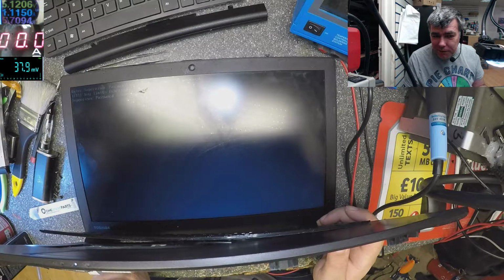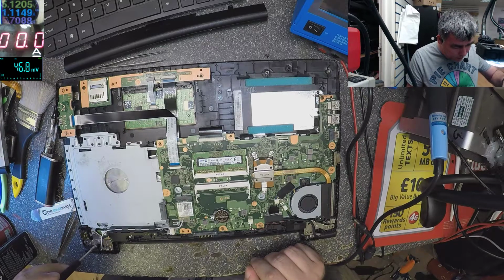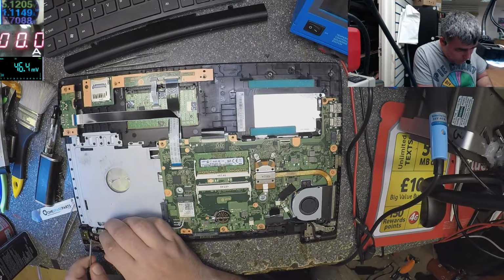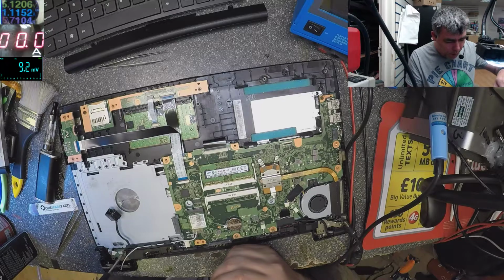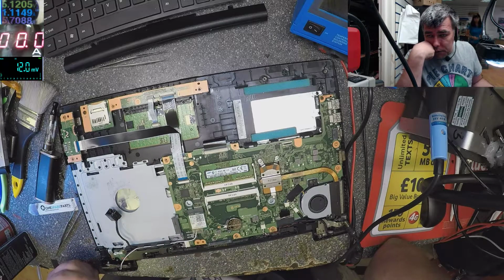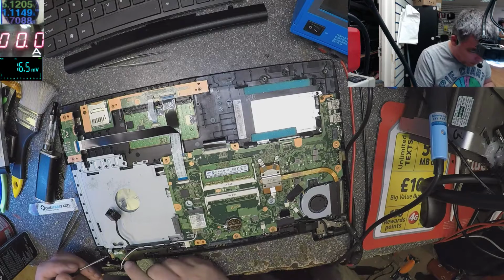And the laptop is on. Actually, it's a power button issue. Okay, let's find the problem exactly. Water damage. So that's the thing: if you have 3.3, just short the pins to ground and the laptop should come on. Obviously, if you plug in the charger, you have voltage, it's charging, but when you press the power button it's not coming on, probably what I will check is the power button. Before thinking of complicated things, actually the things can be very easy like this one.